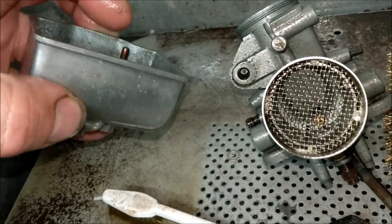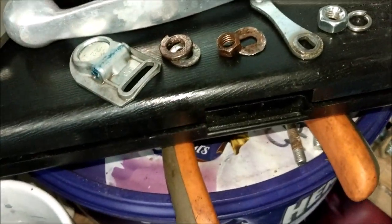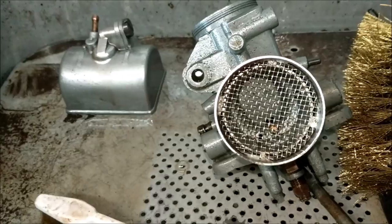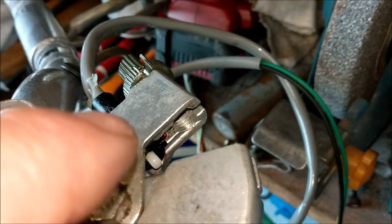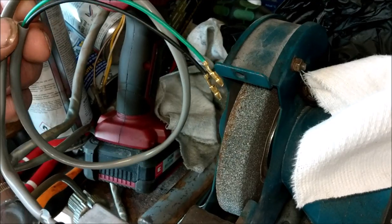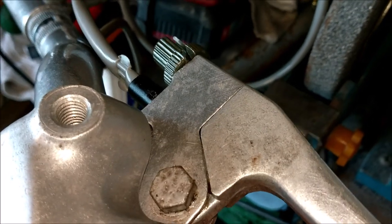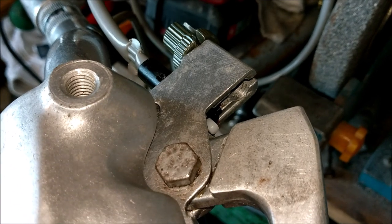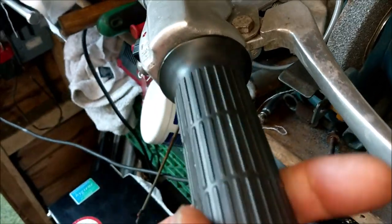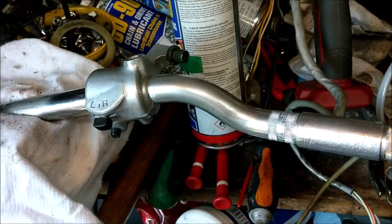I've been here for an hour. There's the choke mechanism all out, just needs to go back in now - give it a good dry clean up, make sure everything goes back together properly. I've installed the new front brake light switch. When you pull the brake the light comes on, when the brake shuts the light goes off. That's all done. Yeah, it's not looking too bad, I'm quite pleased with that.